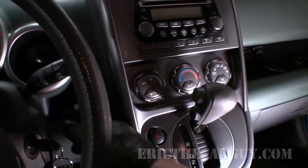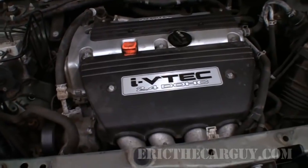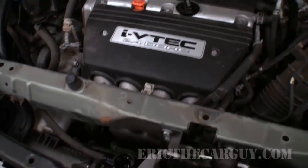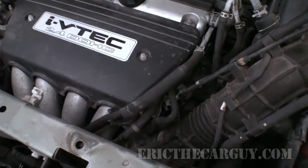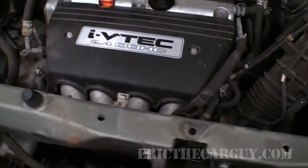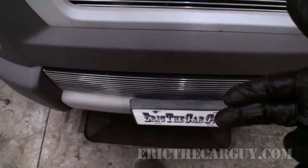So now we'll start the engine. Okay, I'm going to let it stabilize a little bit before I actually start raising the RPM, let it warm up. And then once I do that, I'm just going to reach down here and basically work the throttle. And then I'll hold it at that RPM until the cooling fans come on. And it may come bubbling out here, but I've got my pan ready to catch stuff.